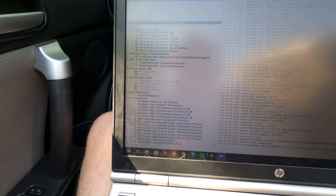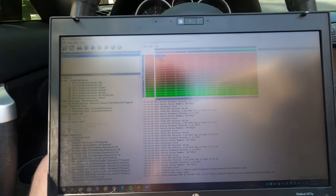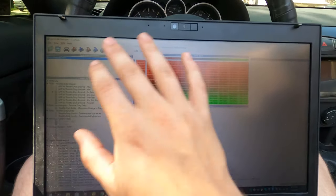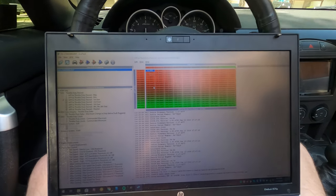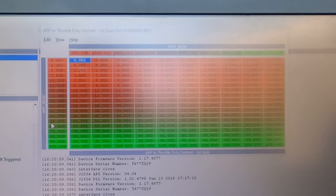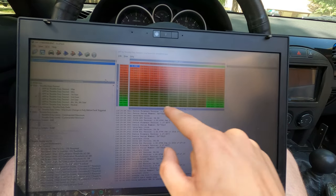And the other thing I want to do is in first and second gear, this applies some weird... Oh, interesting. Oh, no, it's just in second gear. Second gear, but not first. That makes a lot of sense, actually. Oh, no, there is some scaling. It's just different. So I've actually downloaded a stock NC ROM and looked at this stuff before. It was totally different than the values I'm seeing here. There's a little bit of a scaling difference between what you want the throttle to do and what the throttle blades actually do. And in first gear here, you can see at like 35% throttle, it's actually only 28%. And then at 50% throttle, it's 50. But then in second gear, you've got 40% throttle is 34, 70 is 50, 80 is 50, 90 is 50, 100 is 50. It never goes beyond 50% throttle for some reason.